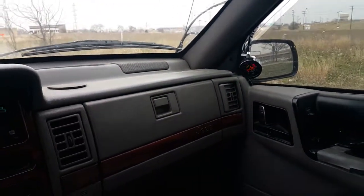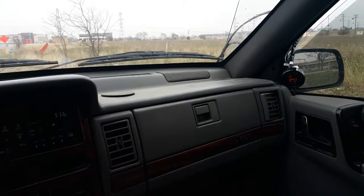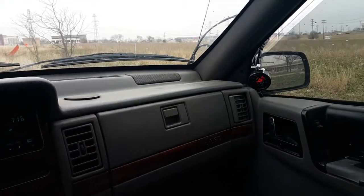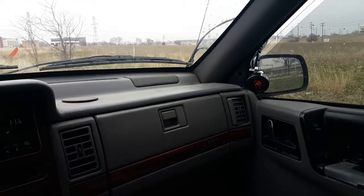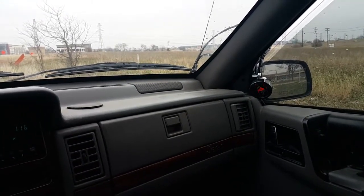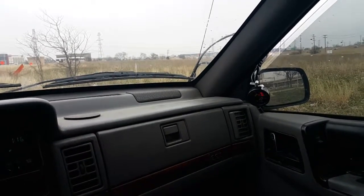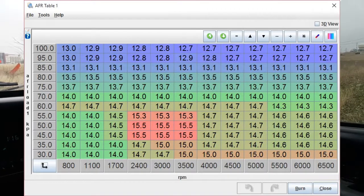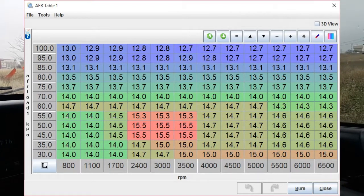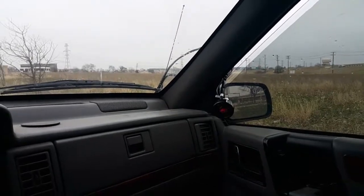What we want to do is go to full throttle, because at full throttle this ECU switches to non-tuned tables which do not have any adjustments, because they're based on maximum performance. This is unlike when you're below 75% throttle, where the ECU has calculated an average of what the best fuel injection is. So we should be getting 13.3 to 1, because that's kind of a lean high-torque fuel ratio. We're going to go full throttle and see what ratio we get.